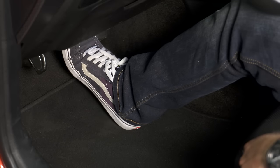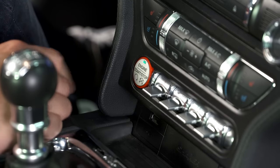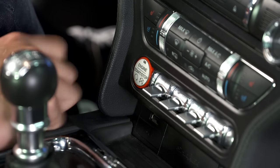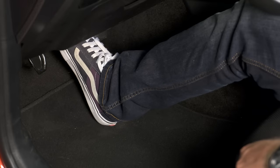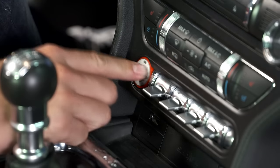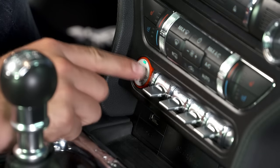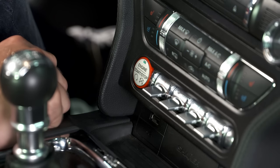To start, press the brake pedal and release it. After that, press the start stop button five times. On the fifth time, leave the car in the start or accessory on position. Press the brake pedal again and release it. Hit the start stop button six more times, and on the sixth button push, the car's horn should sound, letting you know you can start the syncing process.